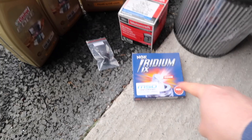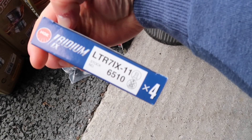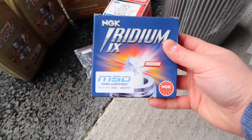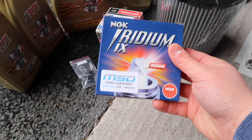I'm also going to do spark plugs. These are the NGK iridiums — you can see the model right there. They are supplied by MSD and are pre-gapped to the appropriate 0.026 inches, or 0.660 millimeters. In my experience MSD always gaps these perfectly. I will check them of course, but unlike other tuners who provide supposedly pre-gapped plugs, MSD actually does it correctly.